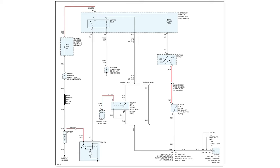We're not going to ignore it, but looking back at our wiring diagram, we see it's a full-time ground. It does go to a bunch of other things, so if it were gone, you would expect other things to be acting up. It's in an area that doesn't get disturbed, there's no switches involved. For right here, it's just a low amp situation, a relay doesn't use very much. So chances are that's fine.